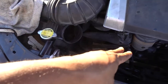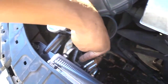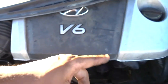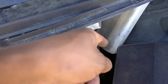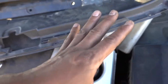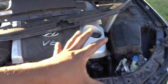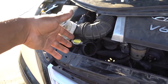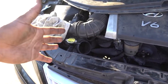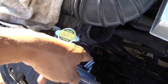Don't forget the two bolts here that hold the condenser and radiator together — one in there, one in there. You'll also probably need to add some engine oil because these two lines run into the engine oil cooler. Check the level — on this one it's kind of hard because the dipstick is broken. The oil is 0W-20. I'm gonna add some before I start running the car, because it's not a big cooler but you will lose some oil.